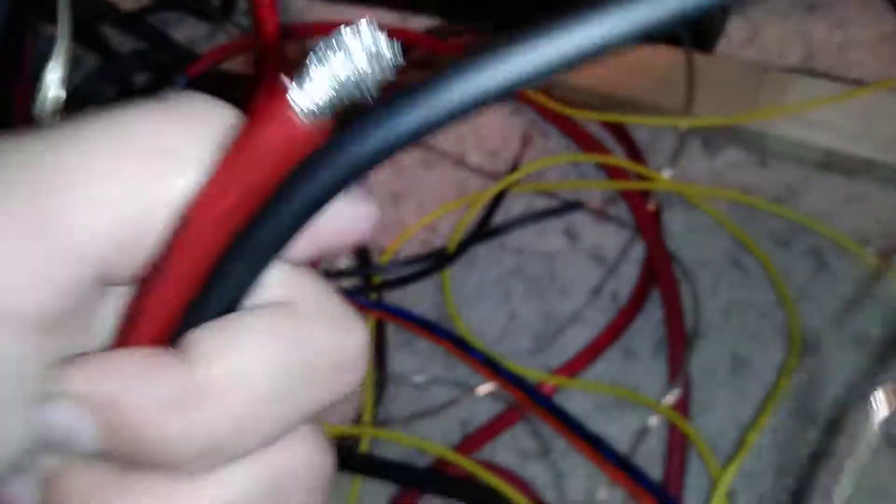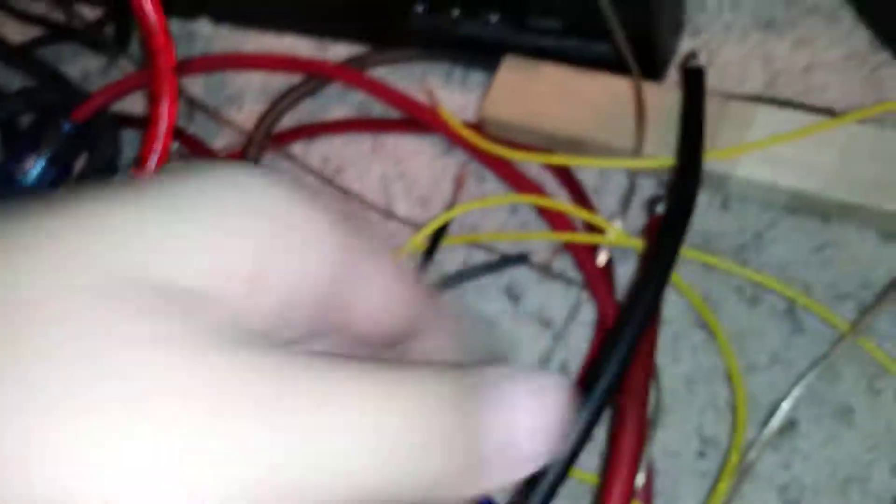That's why it's always proper — if you guys are doing a really, really high-power setup and you're hooking up a subwoofer that takes a lot of power, use thicker wire. Like this 8 gauge here — this stuff is pretty thick. If you're running a subwoofer like this big boy down here, you're gonna need wire like that.